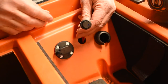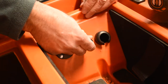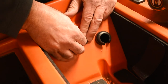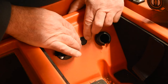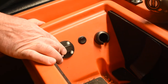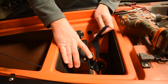So we've gone ahead and tested everything to make sure our connections work and that we had our wiring on our switch correct. So we're going to go ahead and mount that, and we're going to make sure we just go through slow on that. And the switch that we will put in the description, it's just a snap-in switch. So we just want to line that up, give it a good press, and it's in. Look how awesome that looks, guys. We got our main power hook up with the SAE, and we've got our main power switch going to the fuse block. That's awesome.